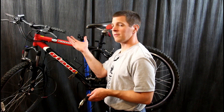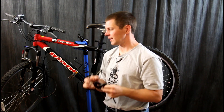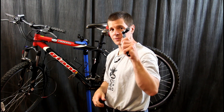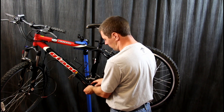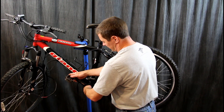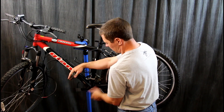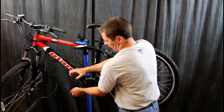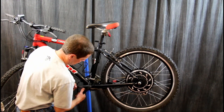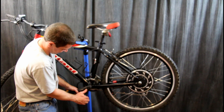In addition to my thumb throttle, I also wanted a pedal assist for my bicycle — that is this magnetic disc and this sensor here. These get mounted behind the crank, and to get it off you're going to need a crank puller. After you pull the bolt off, you thread it into the pedal; there are threads in there that allow it to mate with the shaft. Once it starts mating with the shaft, screw this out until you feel it engage, and then just start cranking. This is fused on there with 20 years of corrosion.